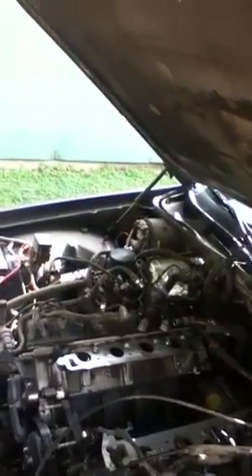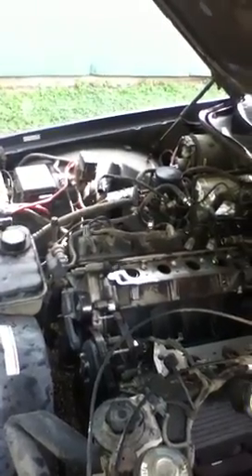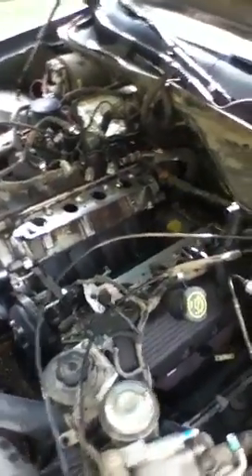Put some fresh oil in so it won't mix. Been dealing with this a long time on these. So let me give you some good advice: if you have one of these with a 4.6 liter and it won't start one day — it's just turning over like the starter's bad, or the flywheel's bad, or it's just cranking and not catching — nine times out of ten you've got a bad intake gasket and water inside the cylinders. That's why it won't start, and that's why it's just cranking. Your cylinders are filled up with water, and most of it has gone down and drained into the pan.